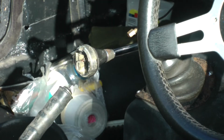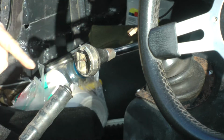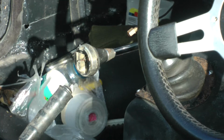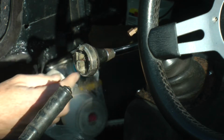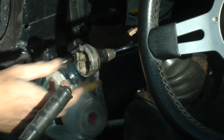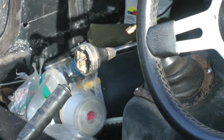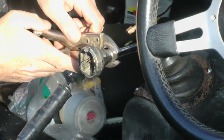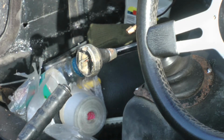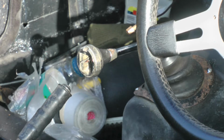I wanted to put the transmission tunnel carpet in first. As you can see, that's not going to fit over that, so I need to take the gear knob off. And there's no visible way of doing that. So I've been on Facebook, and the collective have suggested that you need to take off this taper or loosen this off first, and then there's a lock nut inside. Looks like it's been comprehensively mullered by somebody previously. The stitching on the old gear stick gaiter had been cut down the stitching, so presumably they could just drop it over the top, so that doesn't bode particularly well for whether this is going to come off or not, really. Let's see how I get on.